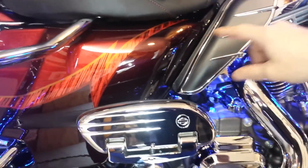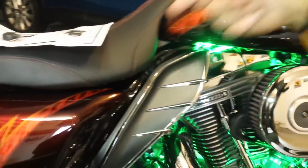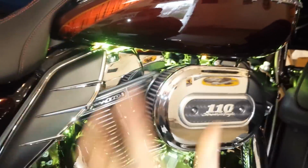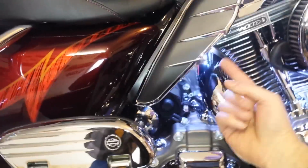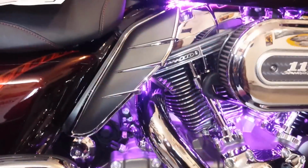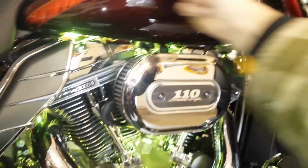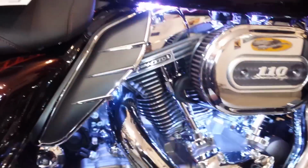Ran all the lines up to this point here. For the 15s under the tank, I go that way with them and then up through the main harness going down. That swallows up a lot of the cable length. And again inside there. Same thing with the 4 inches. I go towards the front of the bike, back up and down, swallows up all the cable length. The one underneath here, obviously, didn't run anywhere, so that one you have to coil up and manage underneath there. The fronts come up through the forks, come up through the neck, and then the kit also includes 2 extensions. With those extensions you can get to about here, and then the extensions bring it over here, again plugging it into the CPU for the Fusion.